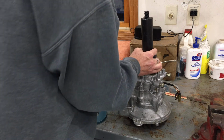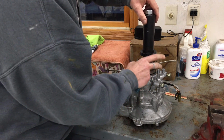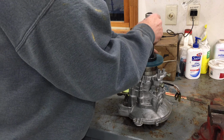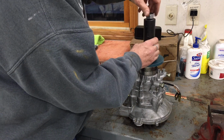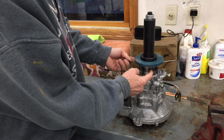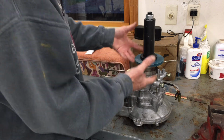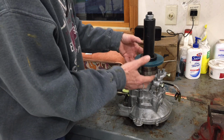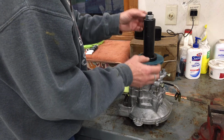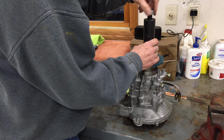Okay, so we got that all together in one piece, and now our puller nut. Okay, but now let's line our collar up and insert our press plates. So now when you tighten this up, in fact there's not a whole lot there. When you tighten that up, now the pressure is on this plate being transferred to this collar, the spacer, to the crankcase, and it doesn't touch the seal at all. And so here is what I would call a relatively proper assembly procedure and simulates the original Yamaha tool to pull the crankshaft through the clutch side of the crankcase after you've installed the oil seal.